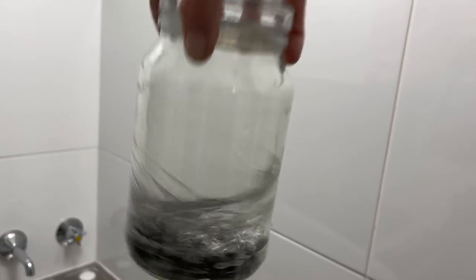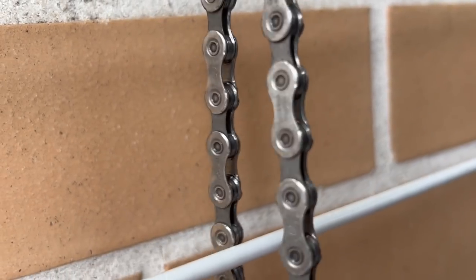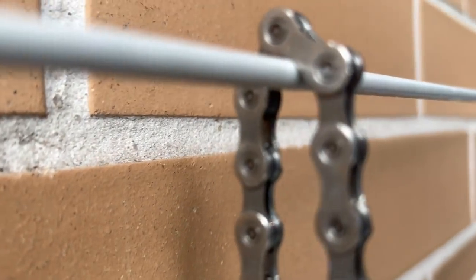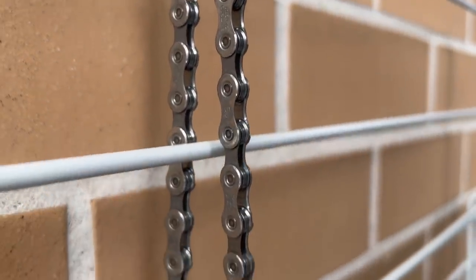The reason why this video is so long is because it's not as simple as just buying a wax-based lube and dripping it on your chain. The caveat to getting this to work well is that the process of degreasing your chain when you first move to a new chain is quite complex. If you apply this to a chain that isn't 100% clean of all existing grease, the wax won't apply properly — it won't stick between the rollers. The chain has to be 100% completely dry and free of contaminants for the wax-based lube to work well.